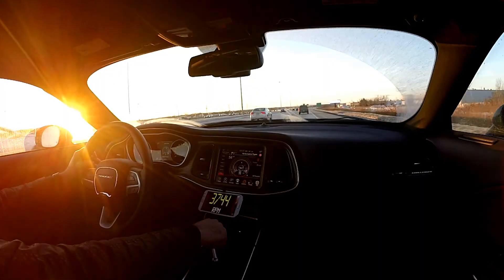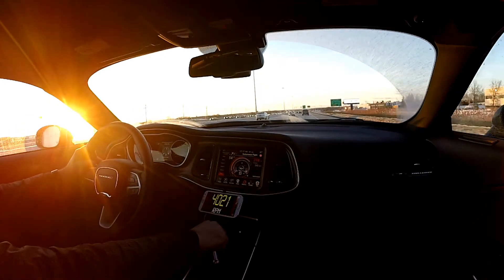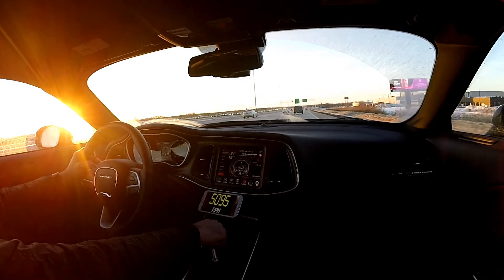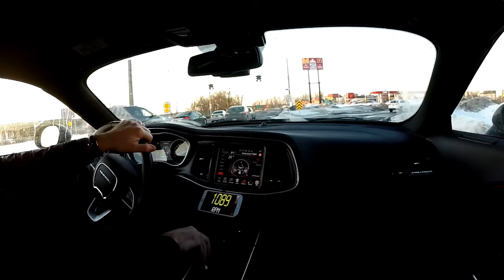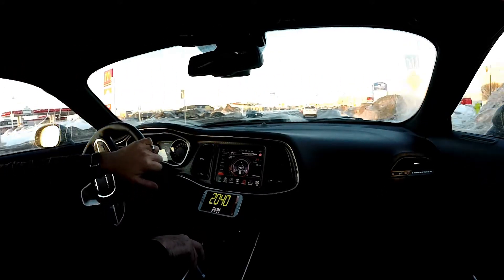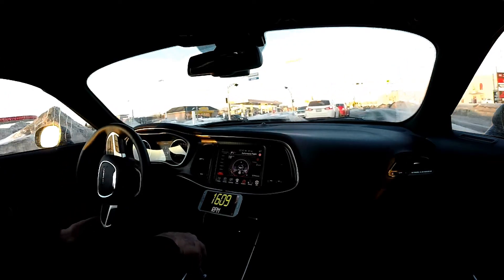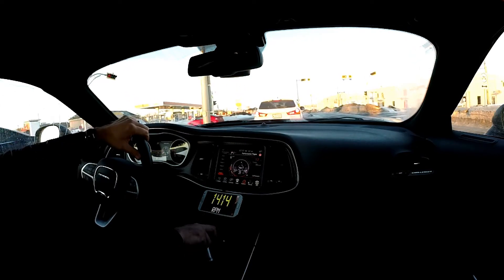This way when you fall back into the next gear you fall back at around 4,000 RPM, and you're falling back at around 3,000 RPMs. You're in a good band of torque, but you're not maximizing the full HP torque band. I think pushing this car past 6,000 RPM would be ideal.